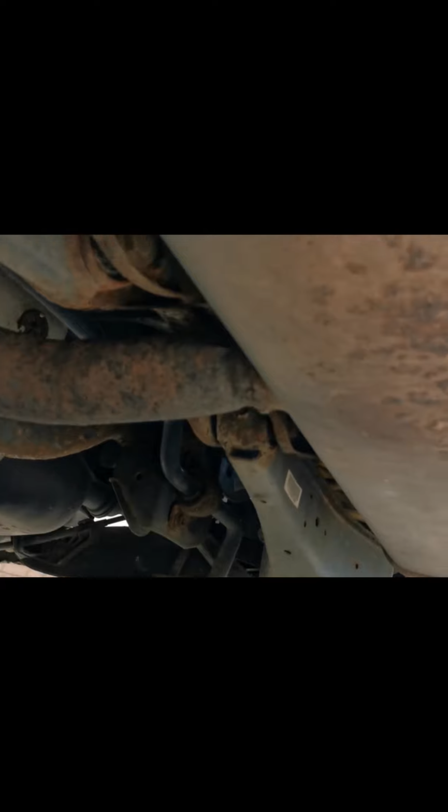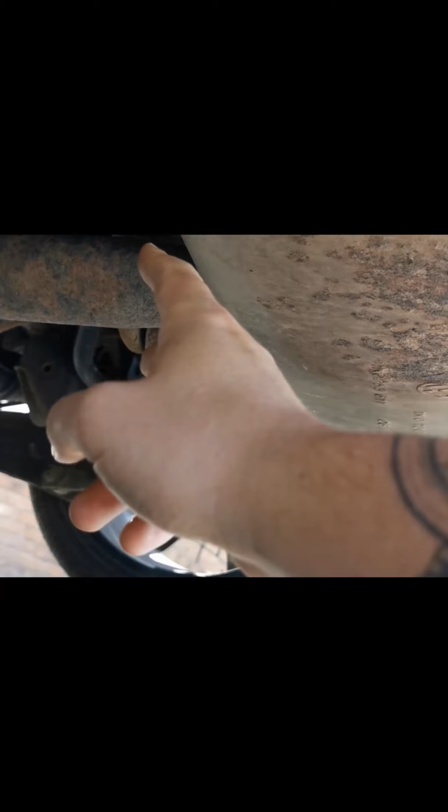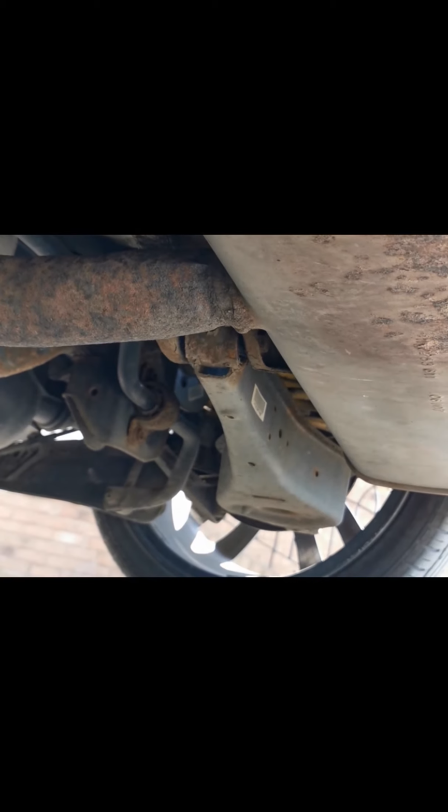So just touching up on the last part of the exhaust from the centre section, which comes out there and comes up to here. What was going to happen is when we get down to this point here, we're going to have a Y piece which is going to stay 3 inch. We're not going to drop down to 2.5 or 2.75. There's not much cost difference in actually continuing on in 3 inches, only about 30-40p per bend really.